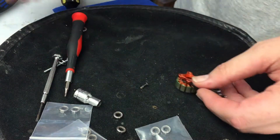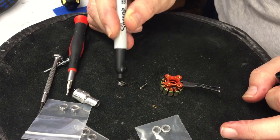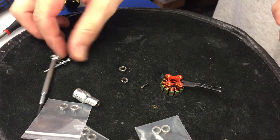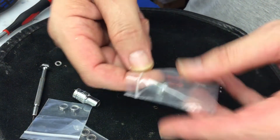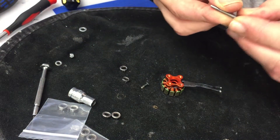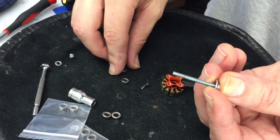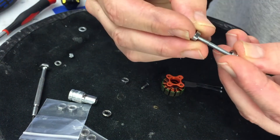Now both bearings are out. What I do when the bearings are out — we're going to reuse these — is mark them with a sharpie so we know these are the ones we took out. Sometimes it's hard to tell. This is the tool I made to put these bearings together. We're going to take two new bearings and two old bearings, plus the bolt and washers as listed in the description. Slide on the washer — or in my case a couple washers — then the old bearing, then a new bearing.